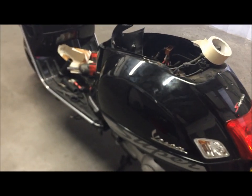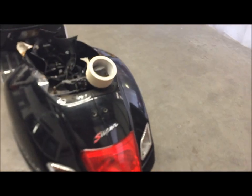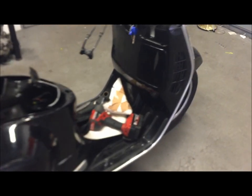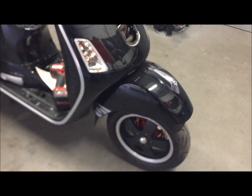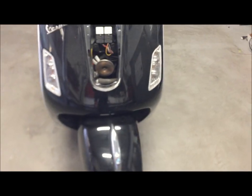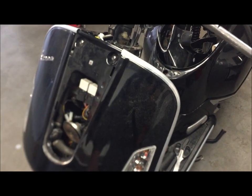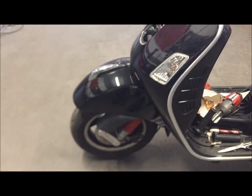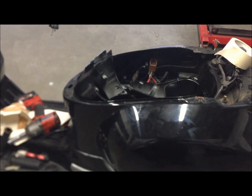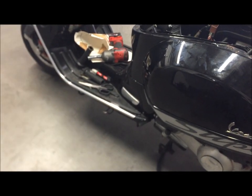We'll probably come up with a cantilever system on the front engine mounting, which will allow the machine to squat down, along with a bag on the front suspension to allow the front to drop 50-60mm as well. We're going to take out these indicators and maybe do a different horn cover — try and get a bit of a throwback to the PX style — and do something with the mudguard as well.